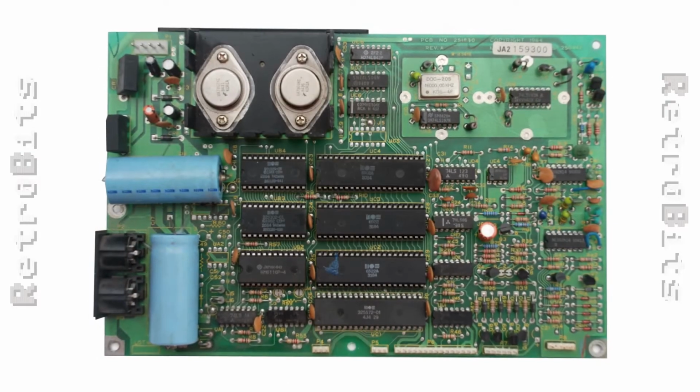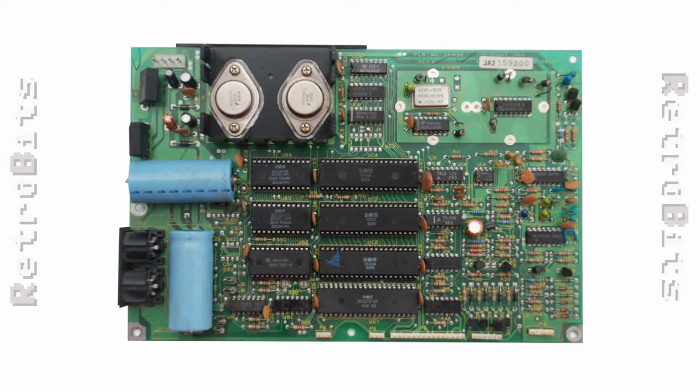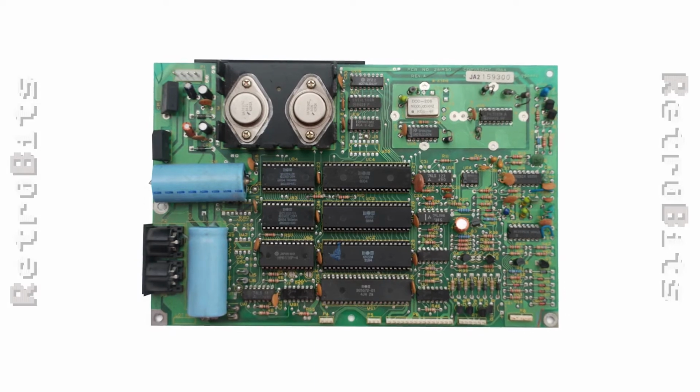The SD2IEC does not attempt to emulate a 1541's onboard 6502 processor, ROM, or RAM, which leads to incompatibilities that we'll also discuss later. What the SD2IEC does well is it allows you to store gigabytes of software, disk images, music files, and more on an SD card from your PC and access them quickly and easily on your Commodore. And when I say quickly, I'm not kidding around.